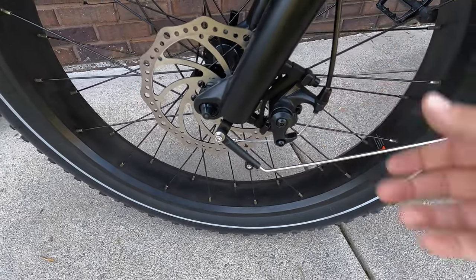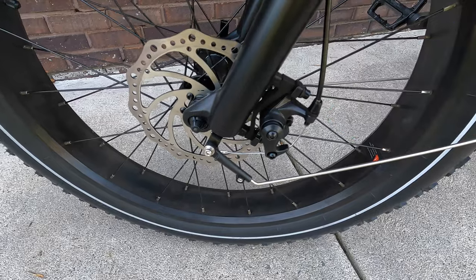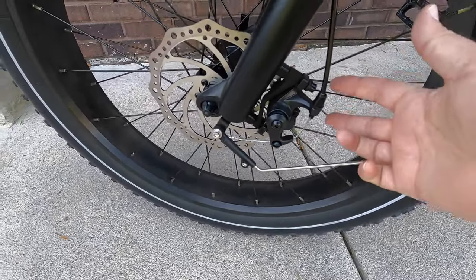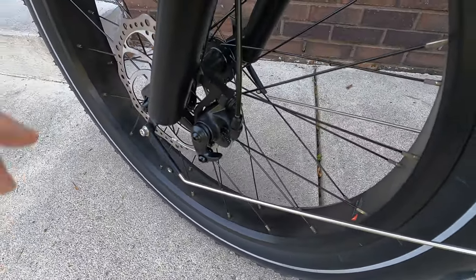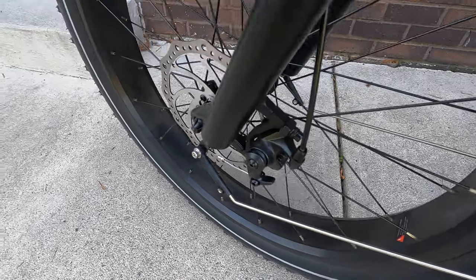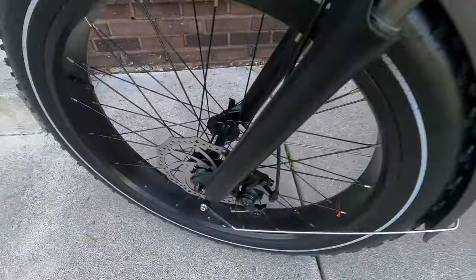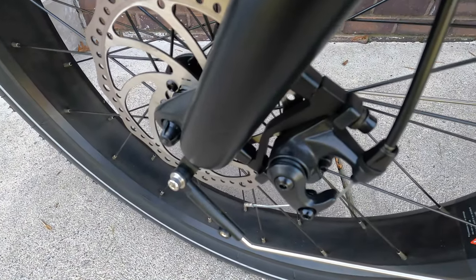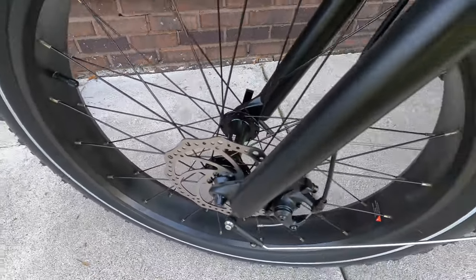Make sure this barrel nut down here is also tightened down all the way — that's another adjustment that can be made in the field after the brakes are done. If they start to stretch a little, you can pull this out to tighten them up a bit. Last but not least, we're going to loosen these two bolts so we can press the hand brake down and then tighten them back up, which centers the brake on the disc.